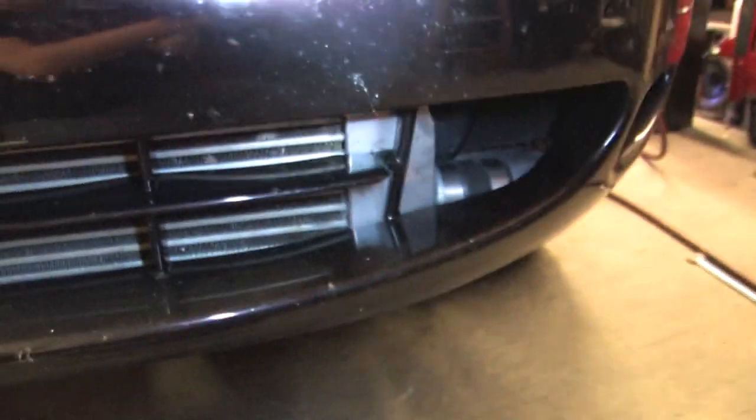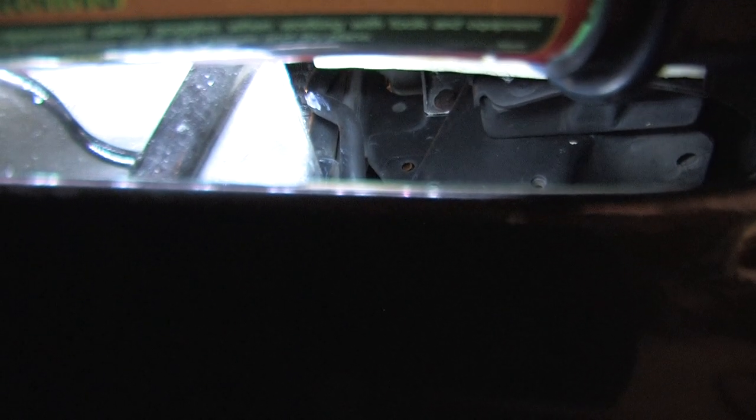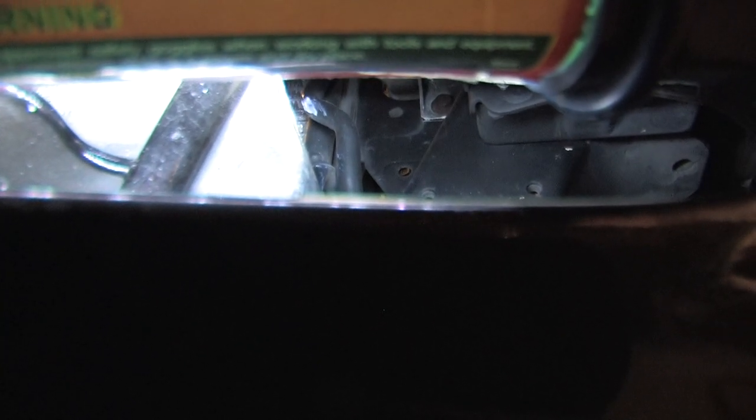So I'm going to take the front end of this car off and yank the intercooler. Some of you guys haven't taken the front end of your car off before, and mine's already been hacked and chopped. There's a hidden bolt that is way up inside of there that holds onto the bottom bracket on the headlight.